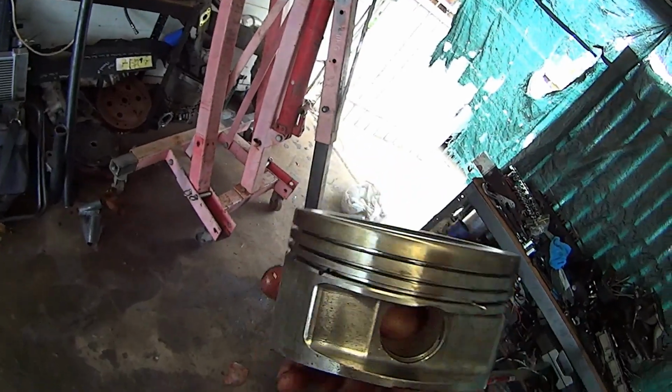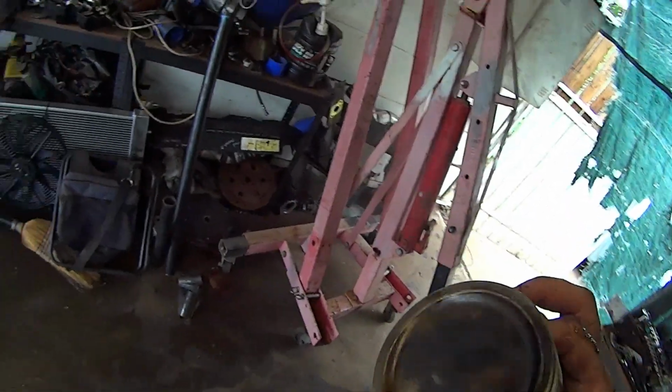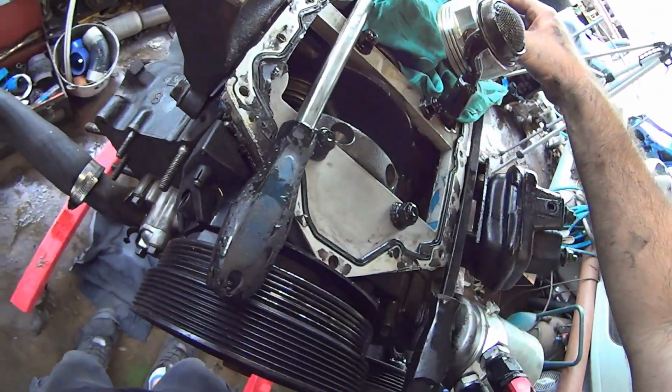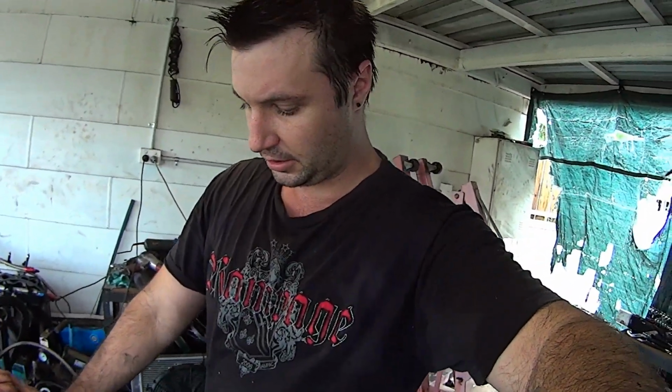Now they've got this out, this can go with the block to the machinist. They'll machine torque plate, bore and hone it to match the piston. So in the next video I'll probably continue tearing this down. That's as far as I'm going to go today. It's hot, I need a shower, I gotta go get something to eat, etc.